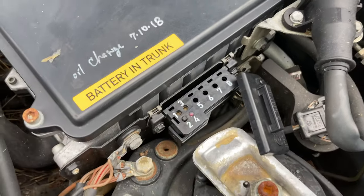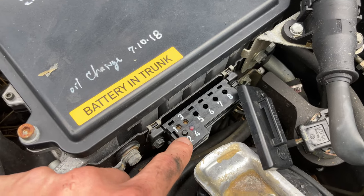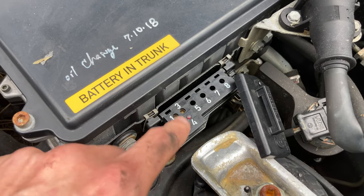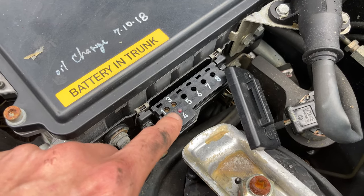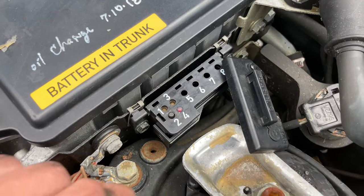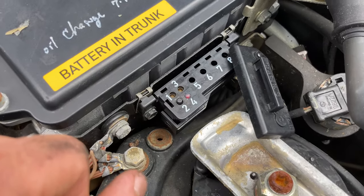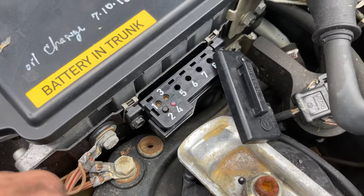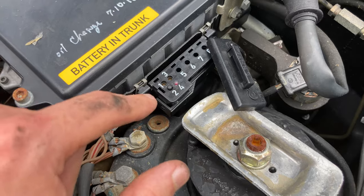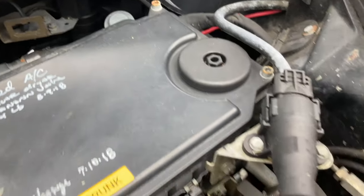The other thing I'm going to do is read the codes, because it has that check engine light and the coolant light. Luckily it has the IM readers — an 8-pin one — and it's got the flash button because this was originally a California car. A lot of these, if they weren't California cars, didn't have the button on them and you have to buy the separate scan tool aftermarket. If you need one, buy one from Rick Potter at Mercedes Source — it's like the best thing you can find, about 30 bucks on eBay.